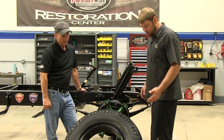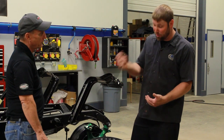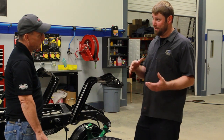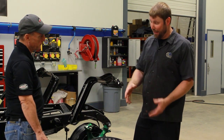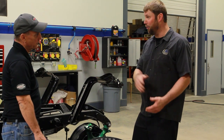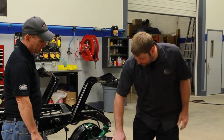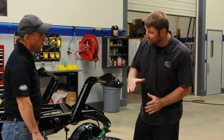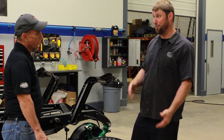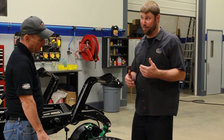When we break them down, you have to beat the tire and outside lip down far enough so you can pop the outside lip off. It's oval-shaped, so if you can imagine you've got a circle and an outside lip that's oval, it's not touching all the way around. The outside ring, when you're airing the tire up, if it's not set just right it will fly off — and that's why a lot of times it's called a suicide rim, because people doing it are pretty much committing suicide.